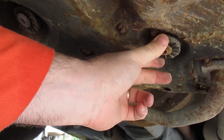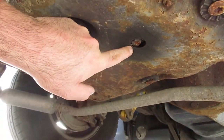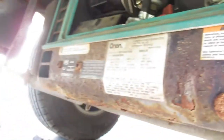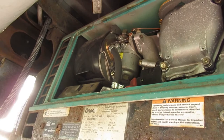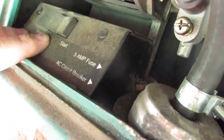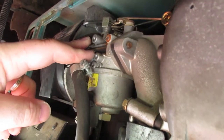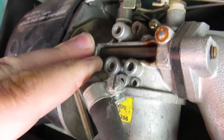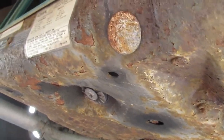Something to look at — I found that these rubber mounts are completely worn out on this generator. It's got about 200 hours on it, though I've never actually used it. That's the oil drain plug there. The oil filler is here. I like the way the newer Roadtreks are done where they just have a big battery bank underneath instead of having to take care of a generator, which is kind of noisy — they just have a second alternator. There's a start switch here, I have the battery hooked up to this unit still, so we're not going to touch that. There are fuel filters right there. On eBay you can get a complete carburetor for like $30 for these things — I don't really understand how that's possible. I think this one needs to be cleaned as it stutters a little bit. I think that's how you change a spark plug, through here.